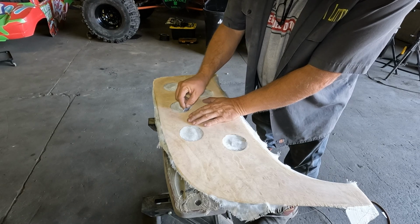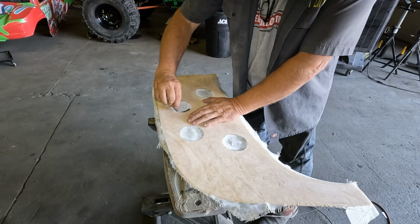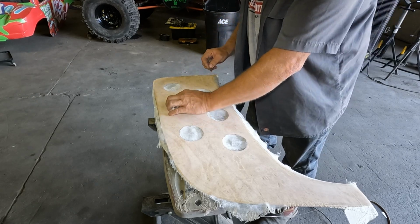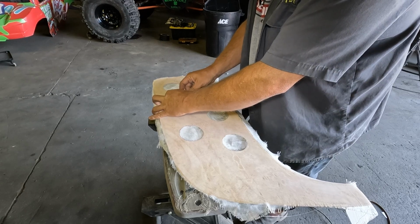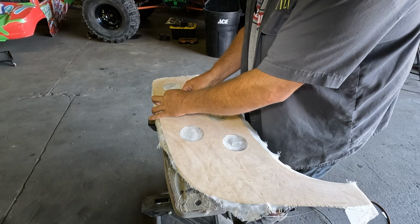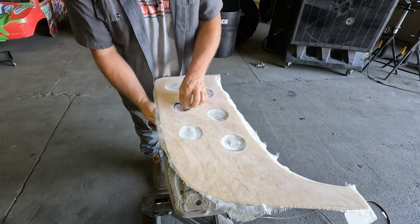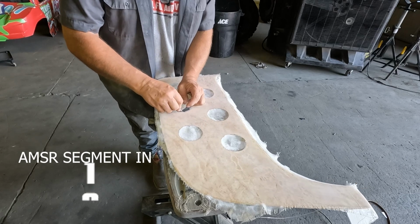Gonna leave probably enough to try to fold it around. I may need to cut some stress points in here. I have a pretty healthy coat of fiberglass, and it's not like this is gonna be outside all the time or submerged. Just looking for that little bit of extra protection. So even if I just get a coating of it on the edges of the wood, with just the resin by itself, it should help exponentially on that.